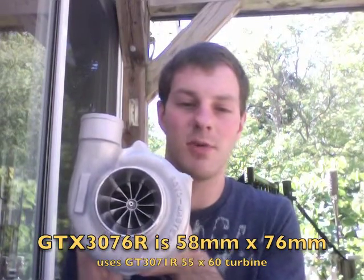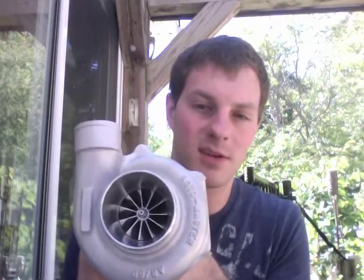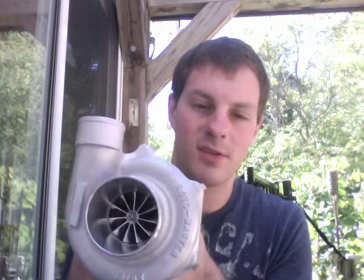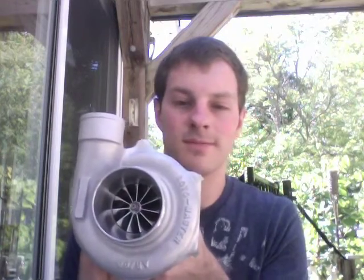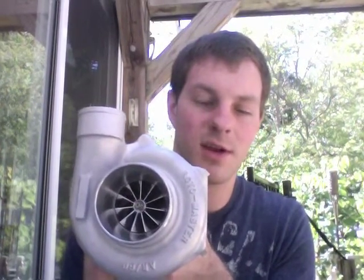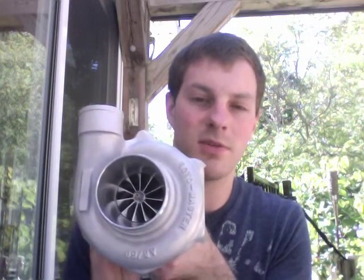The main reason is that when you start to max out the turbo, you really need methanol injection or something to cool it down, because it's going to be blowing a lot of hotter air near the max. I would safely shoot for 425 to 450 horsepower with the 3071 R. Thanks for watching this video and please subscribe to the channel.